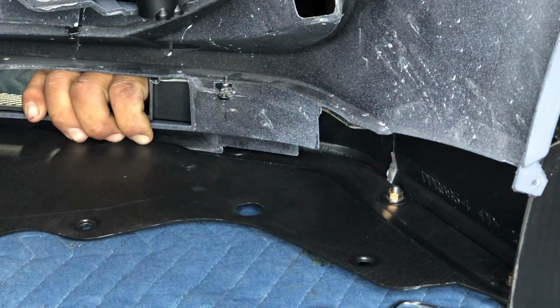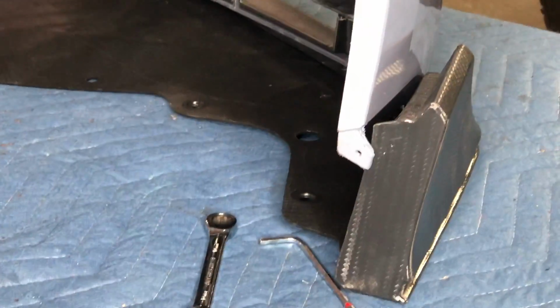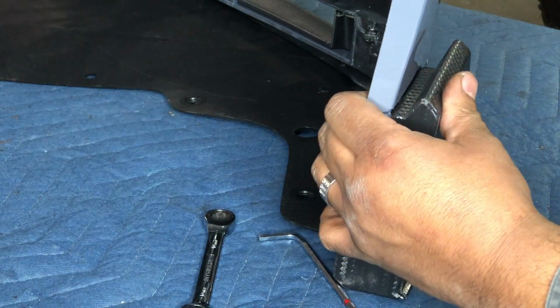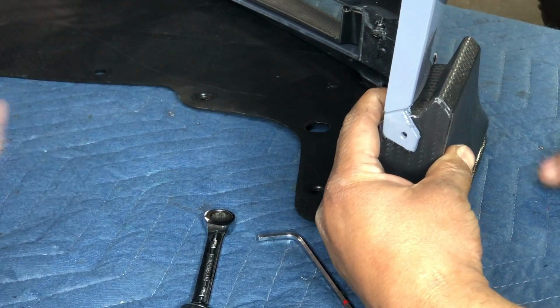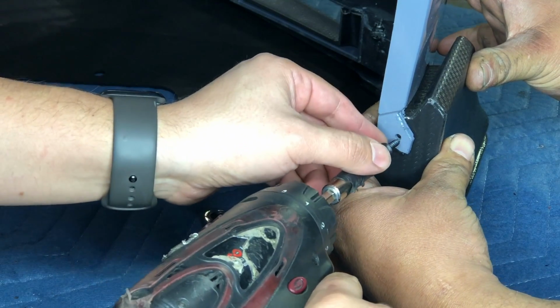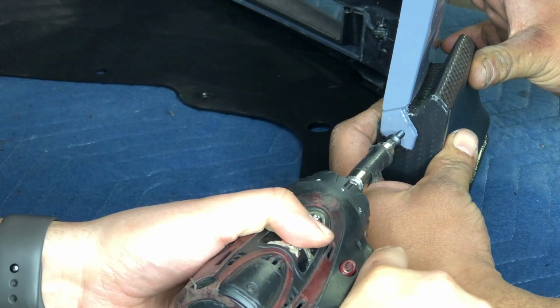Alright. Besides that, the only other one we have left now is right here on the corner of the bumper. So you gotta line this up till the bumper lines up best on the corners. Same exact thing on both sides, and then just put a screw in the hole. And this piece goes on the outside, don't try and tuck it on the inside, or you'll probably end up with like a weird gap. It looks good right there? Mm-hmm.